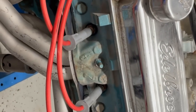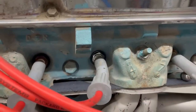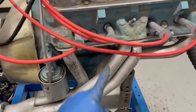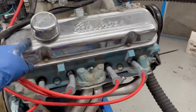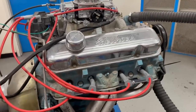We tried a new spark plug and even tried switching the wires from one to the other, but this cylinder still has no heat. So now it's time to pull the valve cover and see what's going on. We'll also take all the plugs out and do a compression test to see how everything looks.